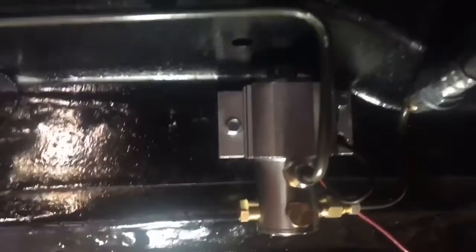So there it is right there — that is my line lock. This line here goes to my left and right lines. And this line here I went ahead and pre-bent — that's going to go to my master cylinder right up front inside the engine bay. I'm going to be running exhaust through here and it's going to go underneath the third member, so it's nice and tight up out of the way.